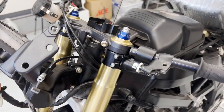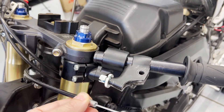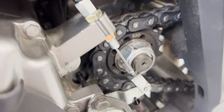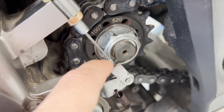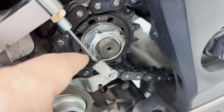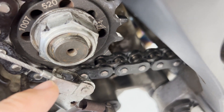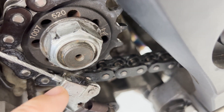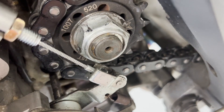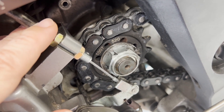I tried it initially attaching the lever end first, but then I found I didn't have enough room down at the engine side. Part of that was because this little end piece is longer, which makes it sometimes harder to get through that slot. So I changed it up and started this end — got that tab there bent up underneath it. The end of it is actually a little shorter, so you've got to bend that tab further than you did on the previous one.